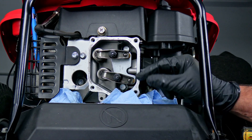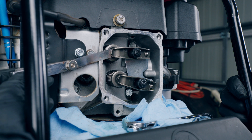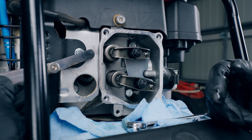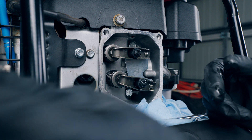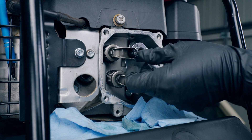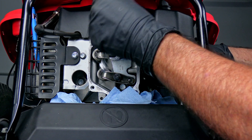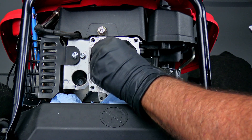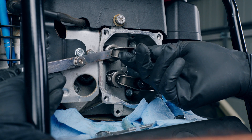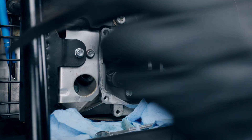I've already gone ahead and adjusted the bottom one — notice we have just a little bit of drag right there, that's the way it's supposed to be. But this top one is super tight. This is actually the way this motor was when I took it apart — both valves were super tight, which disagrees with what's on the engine cover. This one is a 14 millimeter and this one is a 10 millimeter. Put them together and break it loose so you can adjust it. We know it's too tight, so we go back. When we tighten it up it's going to wind up too tight, so if we start off with it being just a little bit loose, when we tighten it, it should be just about right.